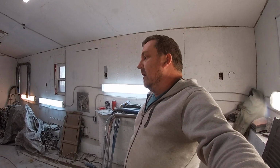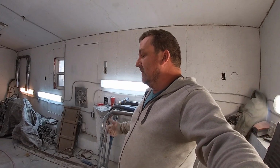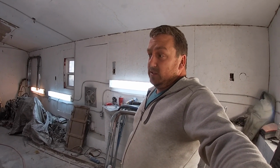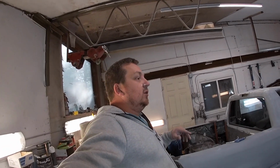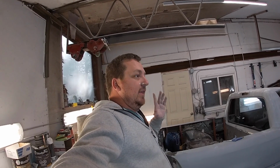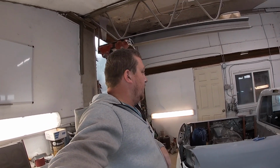So I'll set you guys down. I'll let you watch me. We'll blow it off. We'll turn on the fan in the wall to blow the dust that way. We're going to tape it up. We're going to spray primer. When I spray my primer, guys, I spray it really low pressure, just for the fact is less overspray and it actually puts it on thicker. So a little trick for the trade if you guys didn't know that. So we are going to do it that way.